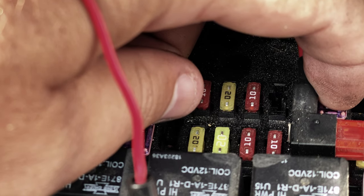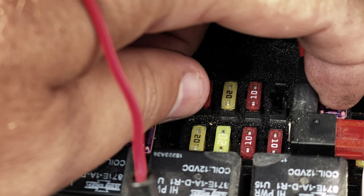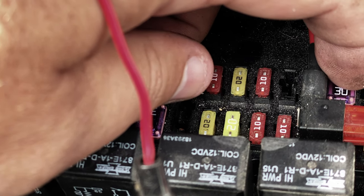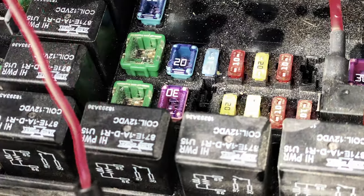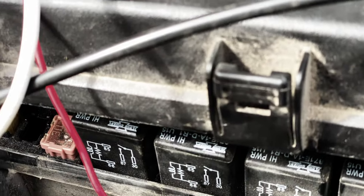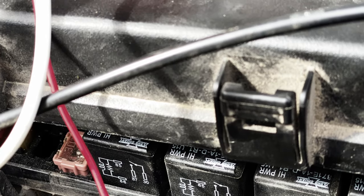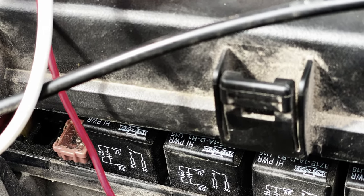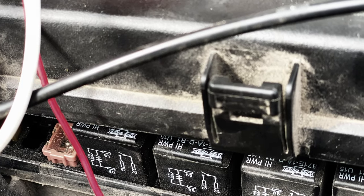As far as I know, this is really definitely your only constant power back to the trailer right here. The rest gets the hots from the other ones. There's only one neutral, and the rest will be getting its hot from the left blinker, right blinker — that's when it sends the hot back. So there's only one neutral that stays neutral the entire time.